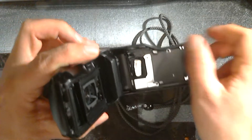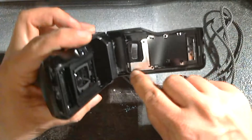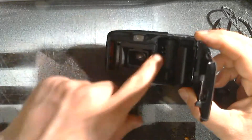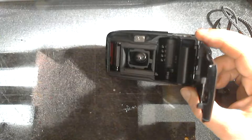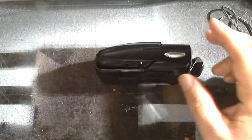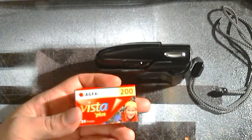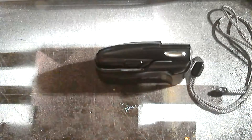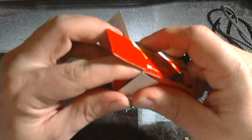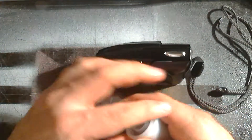They also don't look too bad on the original one and that does have a light leak, so I think the light is getting in from somewhere else in the body. The Mju-2 is an automatic camera so these little pins work with the DX coding on your film to set the film speed in the camera. For testing purposes I'm just going to use Poundland Agfa Vista Plus, which was readily available until recently in a UK shop called Poundland where most things cost a pound. Sadly the supply in the shops has dried up, but I stockpiled a fair bit so I'm okay with running this roll through quickly to test things.